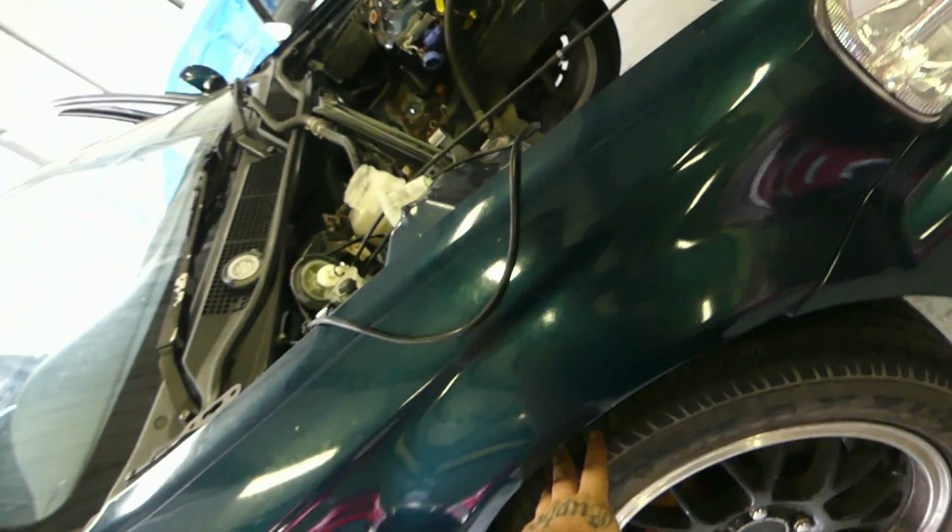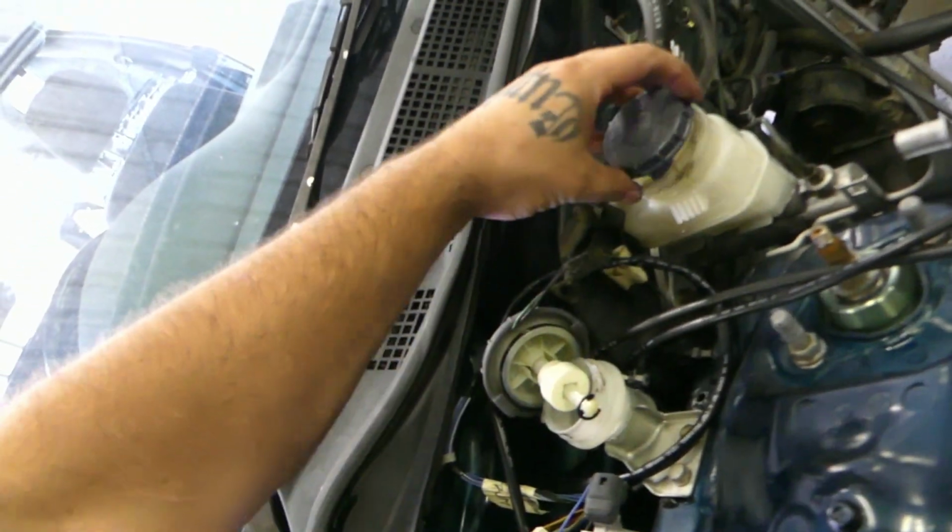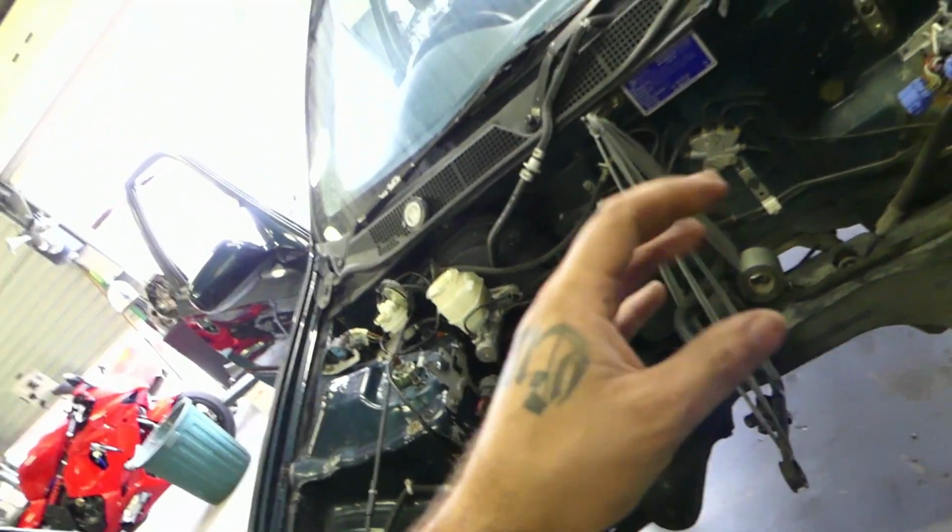these wheels, probably just put down the back, use for rollers on something else if ever I need them. We got our loom here. I've sucked all the brake fluid out of the brakes, all the calipers and everything, so I need to sell those as soon as possible, just so they're not sitting around and they get dry. The old seals, it's not a good idea to have them sitting on a shelf for a very long period of time, because the rubber seals, O-rings start to get brittle and dry, and then they break. You sell them to someone and then they complain that they're leaking and they never leaked before. So yeah, we'll flick those off, sell those as soon as possible,